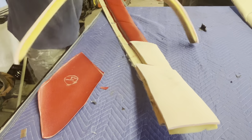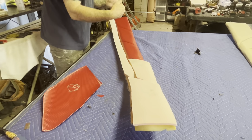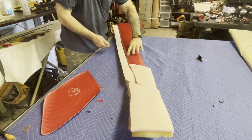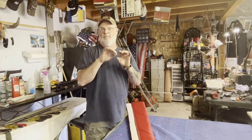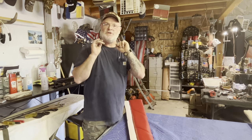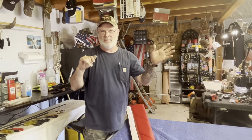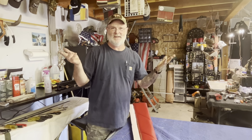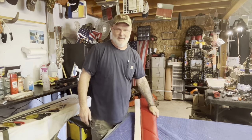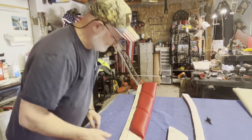And then this piece, got a square butt, that goes right there. Got a piece of piping right there. You got red on the outside, so it hides this. Always do the same color to same color when you're hiding with piping, because you never know. It's just an insurance that the same color's there. So if it does get cut or something and they have to ride with it for a while before they can get it fixed, it kind of matches. I know that sounds ridiculous, but it's a thing, you know.